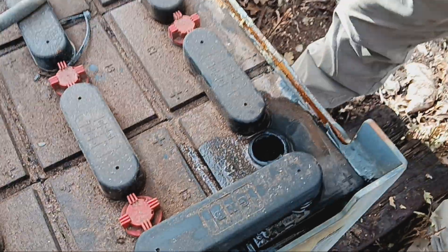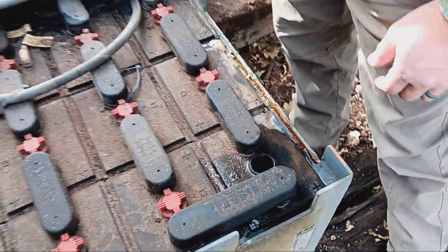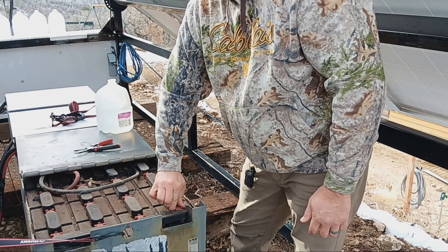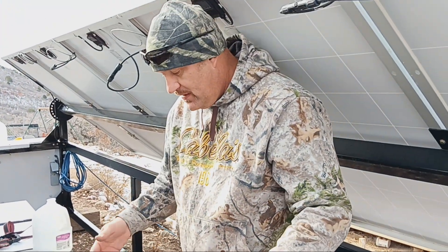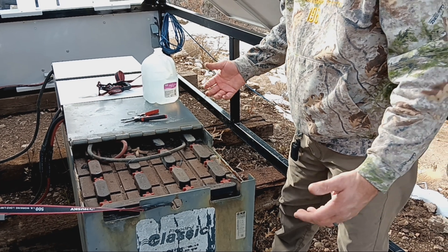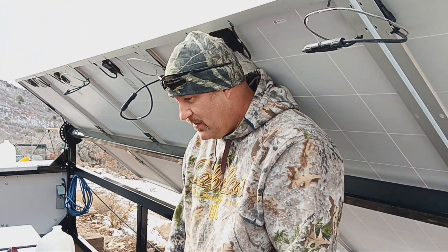Fill right to that point, and repeat that process for each cell. After you're done, make sure all your caps are back on and tight. If you fill them up over that point, they can spill out or cause other problems when they get fully charged. Hopefully this video helps you feel a little bit more confident about how to maintain your battery pack so that your trailer lasts longer. Thanks for watching.